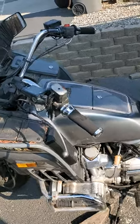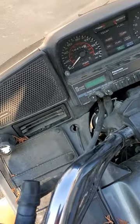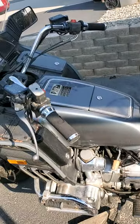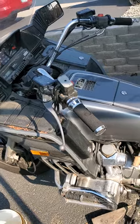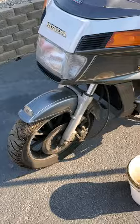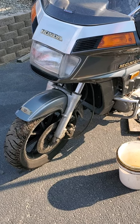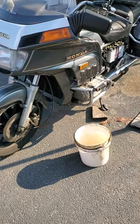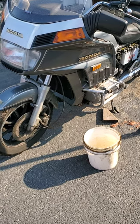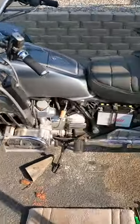It's going to need a lot of work — it's mostly cleaning. But once I get it up and running, I'll have to see what's up with the radio; it doesn't seem to want to find an antenna or a station, so maybe the antenna wire is broken or not hooked up somewhere. There's also a pretty good chance I may have to change the timing belt — whether there's one or two I'm not sure, but after sitting this long it might not be a bad idea. I might also have to flush the radiator. The oil looks really good though, even though it's been sitting — it's nice and clean, so it hasn't been driven much.